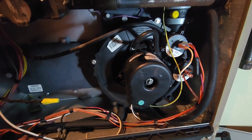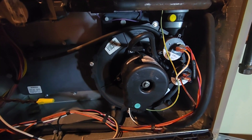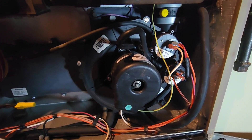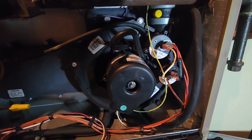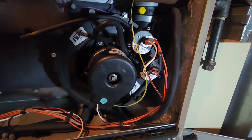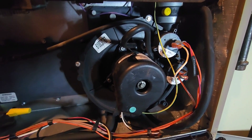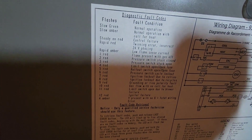If you are here today, you're probably in a bad place. If you're like me, my house is freezing. I'm in Ohio in February, it's about 20 degrees out, my house is about 50 degrees, furnace has been off all night. So what we've done is we came in to check to see what the symptoms were. Down here below, or somewhere on your furnace, you should have a light that blinks. Mine's blinking green. I got the switch pushed in to see if it would show me my error. Basically, I have three red lights flashing in a sequence, and that tells me based on my panel that I have a pressure switch stuck open issue.